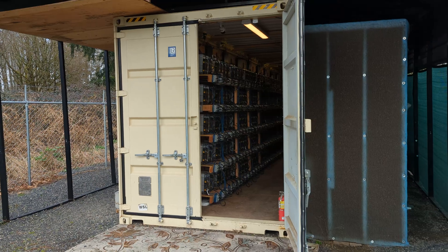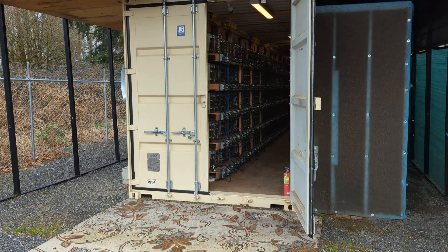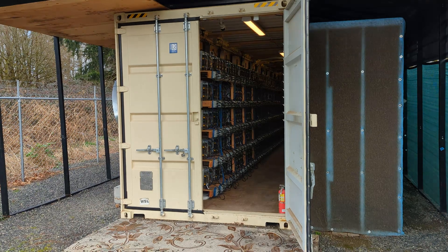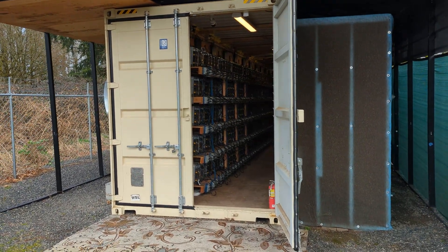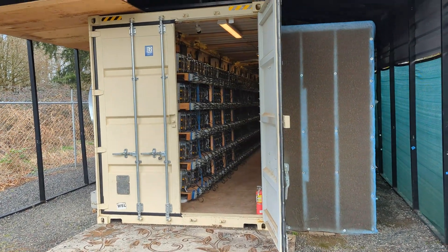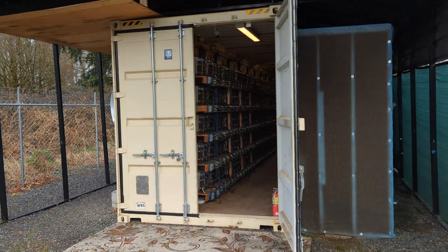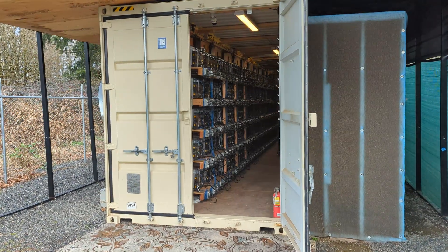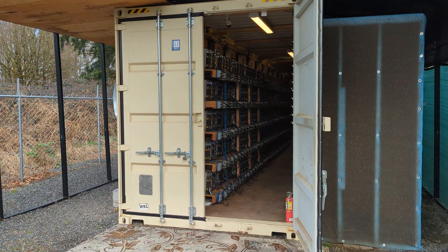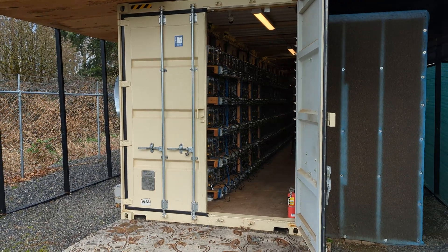We have an Excel spreadsheet there you can check out prices and quantities. I'm going to walk in — it's really loud in there — and talk about the S19 110 terahash miner from Bitmain. Its current stock hash rate is about 111 on average; it's rated at 110 but in reality does 111, and that's at 3250 watts. Right now it's about 45 degrees Fahrenheit out here, so it's pretty cool, and they run at that really good efficiency of 3250 watts at about 111 terahashes.